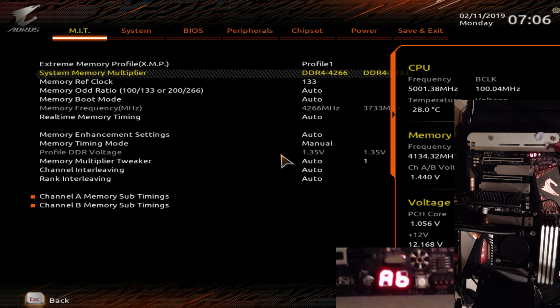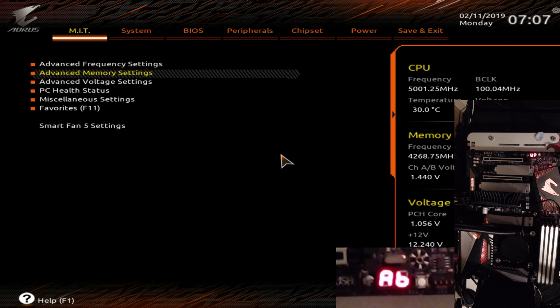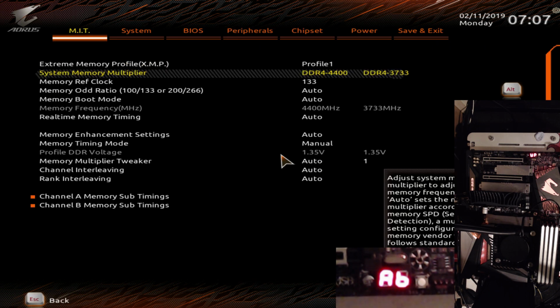Now we're going to go to 4266, and this should still probably work, and I think for 4400, if things go according to plan, it won't post. Okay, so that still trains. And at this point, it should break. Please break, or I'm going to have a really hard time justifying why this video exists. Oh, come on. Break, break. Okay, it did. I was really worried that it was going to work.